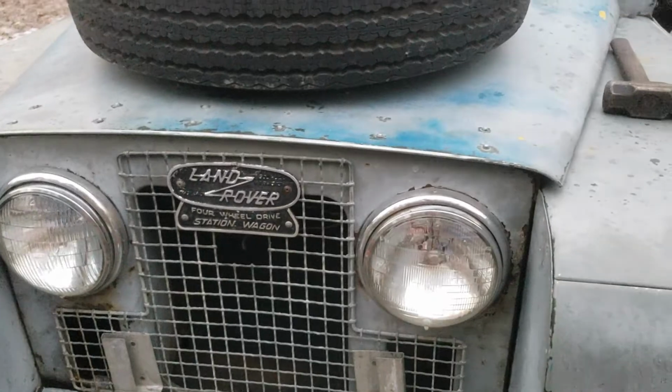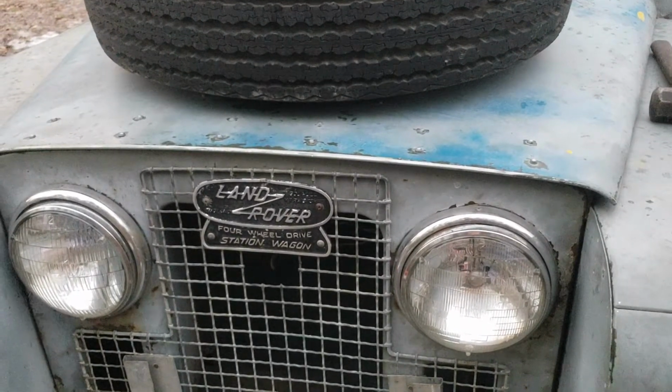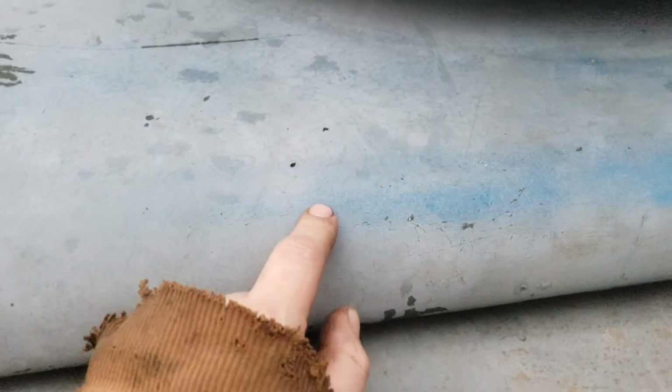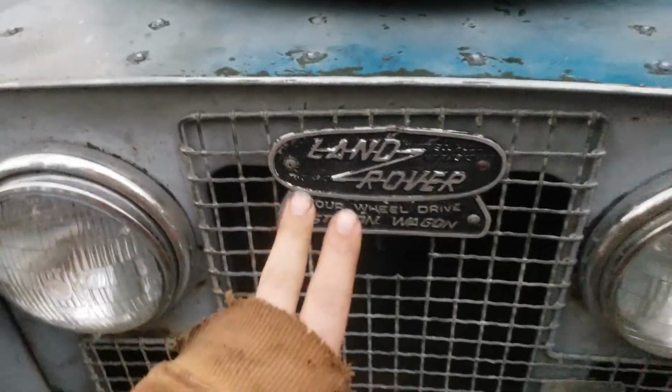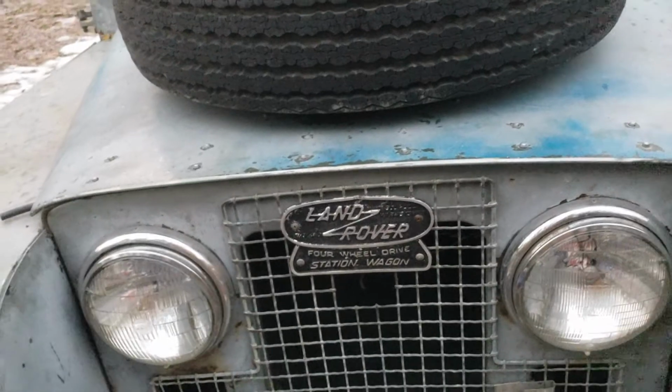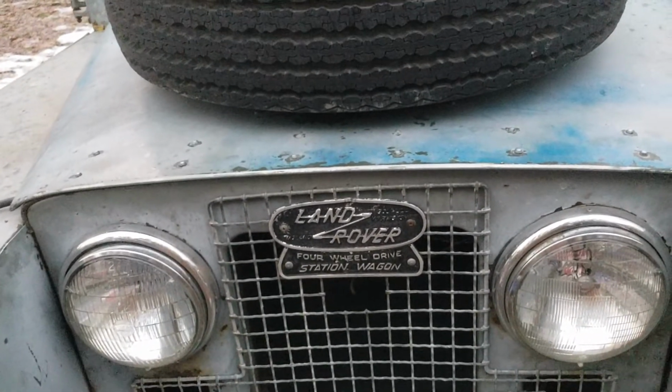But I'm going to be tearing the head off this motor to try and get rid of that tapping that I think is one or two rollers gone flat. That's going to happen this Thursday. My wife and I leave for Maine on Sunday, so that'll be fun. The reason I'm waiting till Thursday to pull this apart is because I'm not sure if I'll have to pull the cam out of here. If I have to pull the cam out of this motor, I need to have a cam to go back in. I've actually got two cams. I don't know if I told you this or not. Got the original one from the 151 motor, which is off at the shop getting rebuilt. And I've got the one out of the Series 2A motor, the 67, that got wrecked by water. I sent them both off to California to Schneider cams, Schneider racing cams, you know.